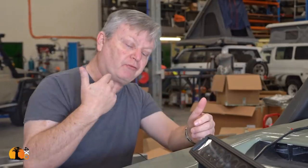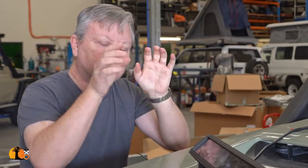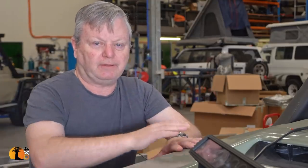And when you then come off high beam, turn them off, with the standard lights, one is almost completely blinded because the eyes take so long to compensate after this very, very bright white light. So not only am I upgrading the lights, I have to, for safety's sake, do something about the standard headlamps. Yes, make them brighter, but more importantly, make the light from the headlamps whiter, so my eyes compensate more quickly to the car's own headlamps when driving on low beam.